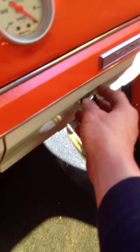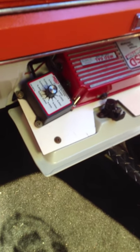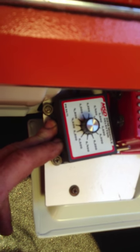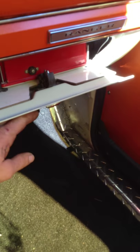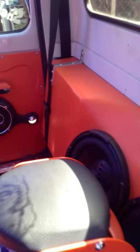Reach over here and open up the glove box — well, it's not a glove box anymore. That's my MSD, just the rev limiter. As you can see, it goes from 4,600 to 6,800 RPM. I can adjust it for when it starts to drop cylinders in its misfire sequence. Lights come on when I open the door — passenger side just turns on the passenger, driver side turns them both on.